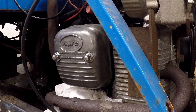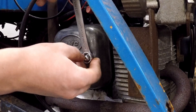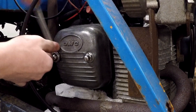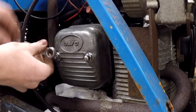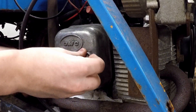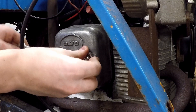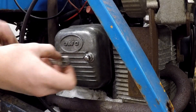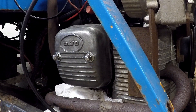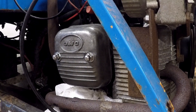It does seem that these acorn nuts are 9/16s, so I've got the wrench here and we'll tighten this one up just a little bit, then tighten this one up a lot more, then finish with tightening this one up. As you can see it already came a little loose, so I'm going to check this one again — that one's pretty tight already. That one's good. So there you have it — got new studs in, adjusted valves, and new gaskets. Should be good, all looking good.